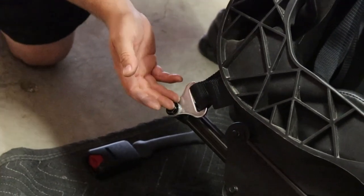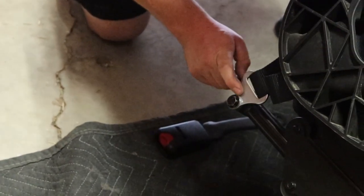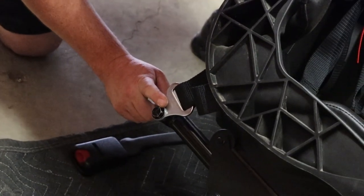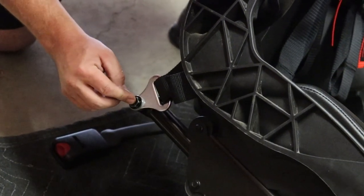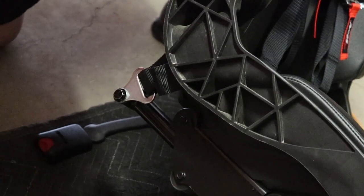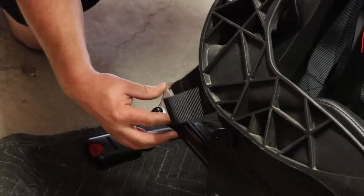So if you have a Can-Am X3, you're going to have all these stock size seat belt bolts. And if you buy these Ace Racing harnesses, you're going to have to drill it out a little bit. So you're going to need that step bit if you want to do it smoothly and not be there for hours on each little buckle. I did all four harnesses in 30 minutes, and that's two buckles per harness, so eight of them, with that step bit. And it did it smooth, and I didn't over drill or leave the hole all ratcheted, and to where it's not twisting like this smoothly.